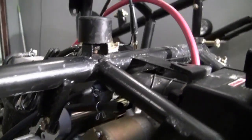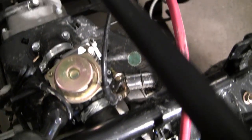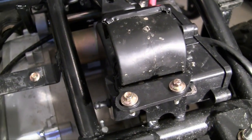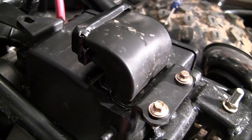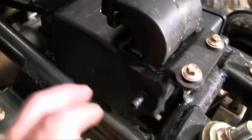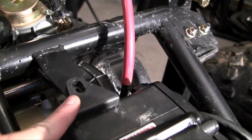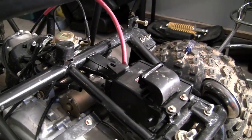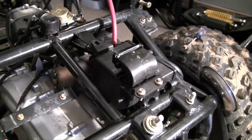Now, all you have to do is sit back and behold your final installation. As you can see, your air filter is now properly connected to your carburetor and bolted on the frame securely. Just remember, whenever I talk about your PCV system, you want to put a hose right here and also up here. And put the PCV cartridge right there — that's where that mounts. But for now, we're just worried about the air filter. Mission accomplished.